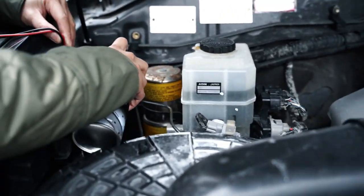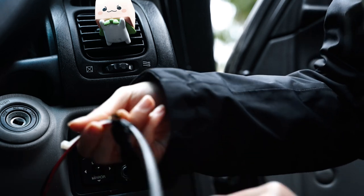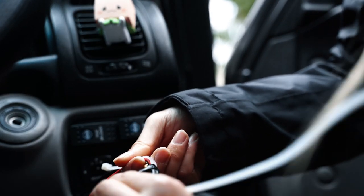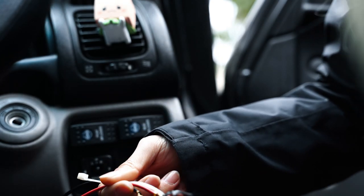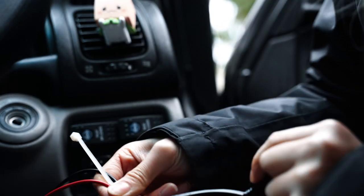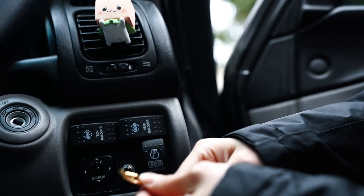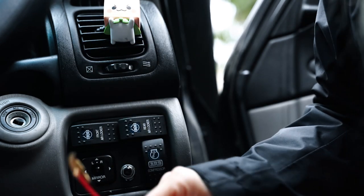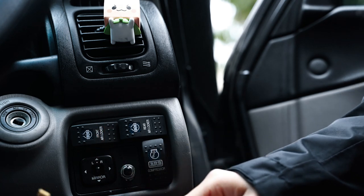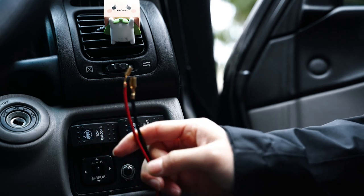Spray some lube and just pull from the inside. The wire isn't really long enough to reach the module and the battery, so I'll extend the cabin side so it can reach the unit in the center console. Since this cable already has a fuse, it's better to have the fuse closer to the battery. So I will extend the cabin side — that's technically safer.